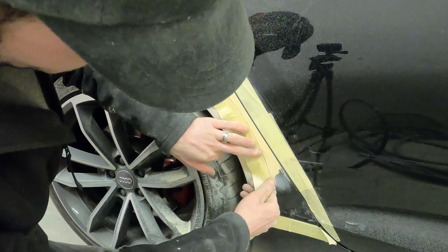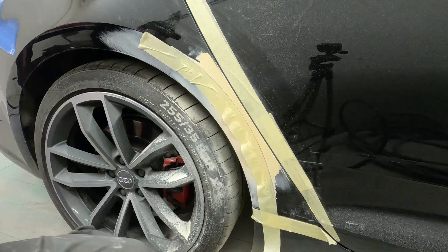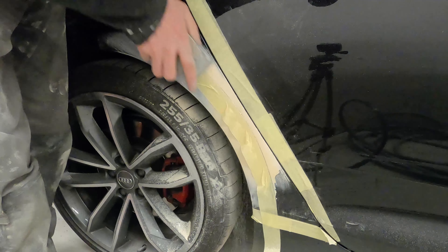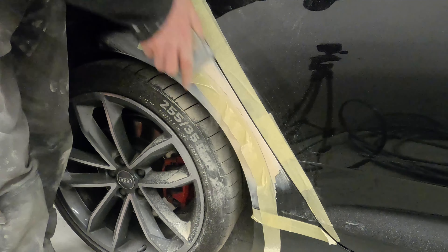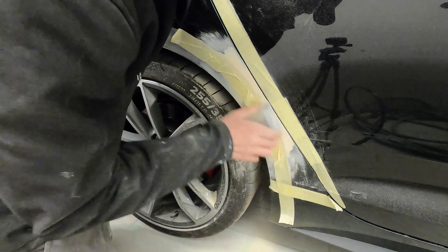Using the pencil line from the arch tool, we're going to put a little piece of masking tape around there to give us a really nice sanding guide to sand up to but not sand off the masking tape. We'll end up with a perfectly masked out line. I'll always step the sandpaper slightly in so that I can keep it off the door edge — one side stepped out, the other stepped in — so we're not going to damage that door in any way. Little things like this can make your life a lot easier and make the job quicker and cleaner.